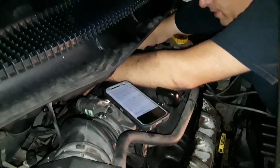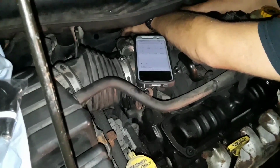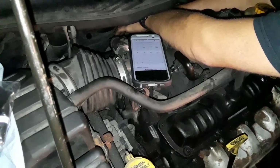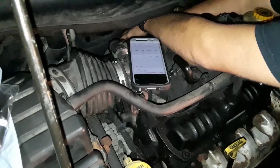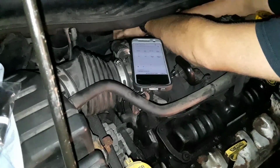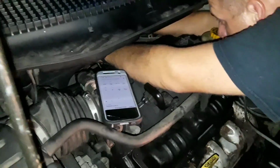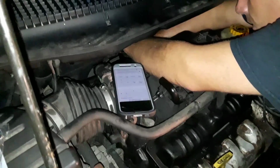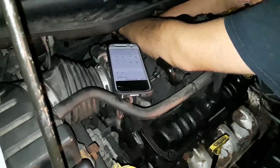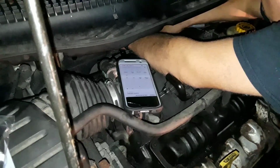Before, I didn't see any of the wires arcing off any of the metal or anything, so plugs don't make a difference. And then next thing to do, I have a spark plug checker just for spark. I'll put the wire on it, clip it to a ground anywhere on the motor, and see if the coil is not firing. Yeah, I think the coil was replaced recently. Yeah, it looks like it was replaced. So I thought they had done the plugs too, but I guess maybe not. Or I put all that goop on it since they changed it out.